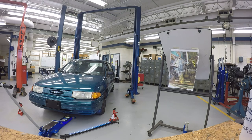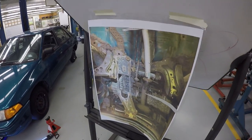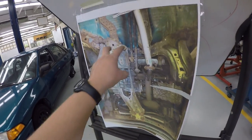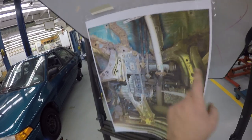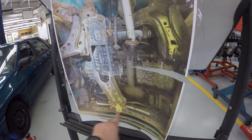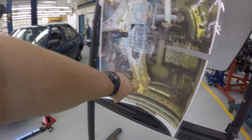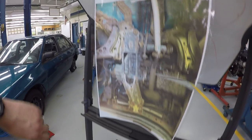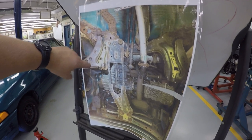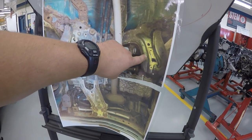Here's a quick picture of the underside of the car. This is the front bumper right here, and this is the support beam that goes under. We have our control arms on the driver side and passenger side. This Ford Escort is nice because we have a good lift point right here that fits the jack really nicely. The jack is going to go under the front of the car right here. Once we raise the car up, these yellow points on the cradle are where we're going to place the jack stands — one on each side.